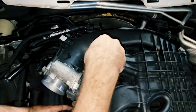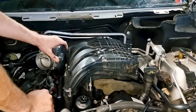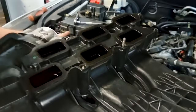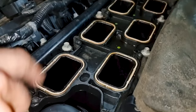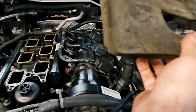This is the one you may have missed, just down in here. Then the top half is off. The reason you want to leave those bracket bolts loose is because the manifold doesn't come straight up — it's got to come towards the driver side a little bit. You can see a little bit of oil on the face of the top half of the manifold. I always recommend replacing these gaskets — get them from Jeep, they're pretty cheap. That bracket goes underneath the manifold on the passenger side.